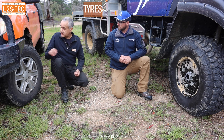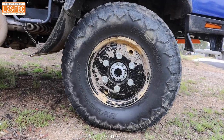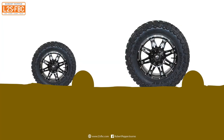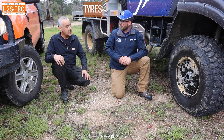These are about 31.5-inch diameter, those are 37, so they're much taller. That means the tire can roll over obstacles a lot easier, but again because of that large differential you've probably got more ground clearance than this, but not as much as you'd expect because of the extra diameter.